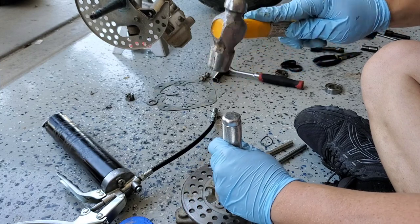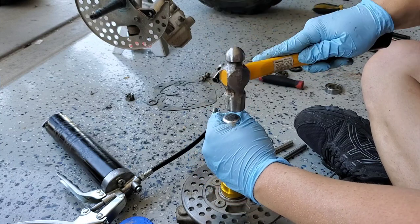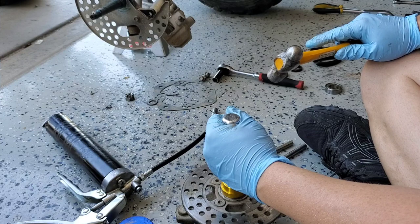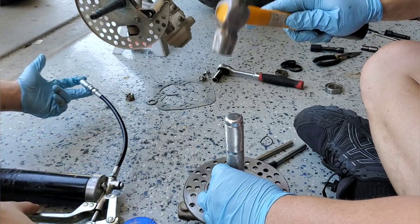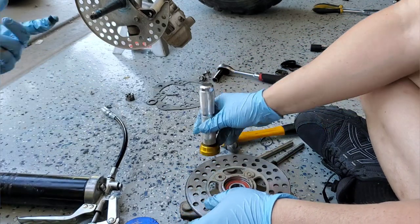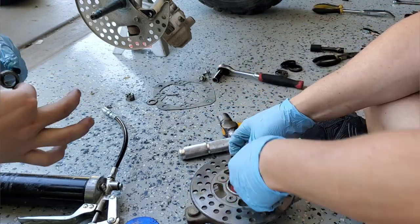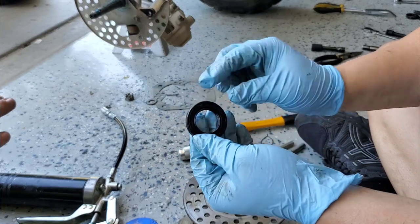My son points out there's a little rust on the seal, but it's not bad. We can use red Scotch-Brite to clean it up if needed. The bearing goes in — you hear the sound change — and we make sure it's perfectly level. Now the last part is our inside seal.